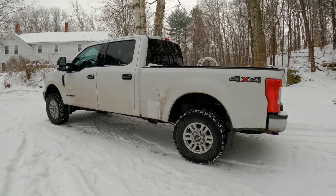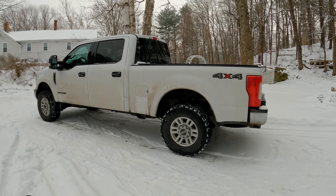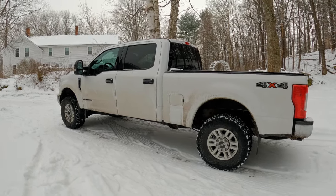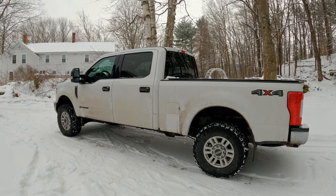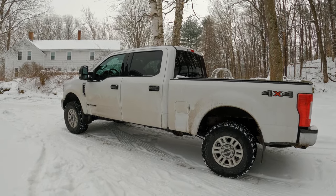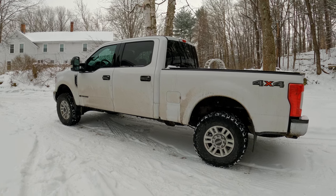I'm leaving it at 45 and 45 - nice and simple. I did do a chalk test and my rears are definitely wearing a little unevenly, but I rotate my tires every 5,000 miles on the dot - every oil change I'm rotating them - so I'm not worried about uneven wear. Lower your TPMS sensor light threshold in your BDCM with FORScan and you can run lower pressures; that is the last piece of this puzzle for better ride quality over stock.